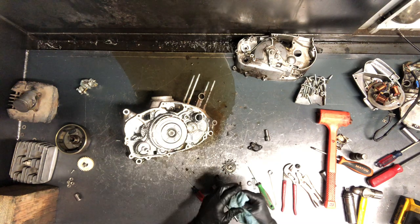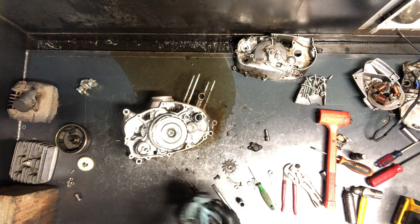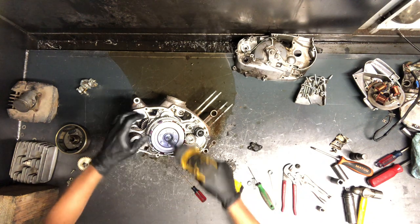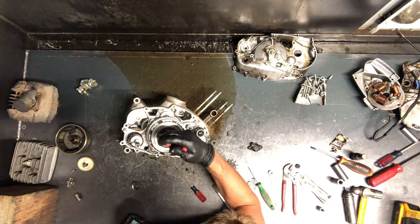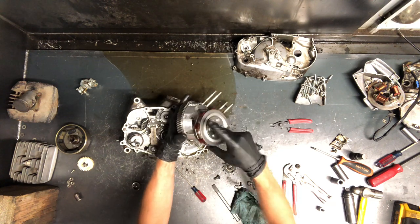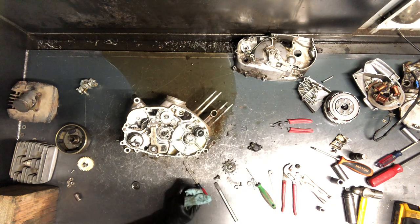This piece that popped off sits on the clutch — this is what the clutch cable hits, so it pushes back on this when it needs to disengage the clutch. We're just going to go ahead and remove this snap ring. A lot of times there's a nut under here. Pull that snap ring off — now we're able to pull that whole clutch pack off as one assembly. You can pull the clutch friction plates and steel plates out and inspect them. Look for grooving right here — it's pretty common; a lot of times these break if they've been abused. But this one looks like it's in great condition. We'll measure those and make sure they're within specs.